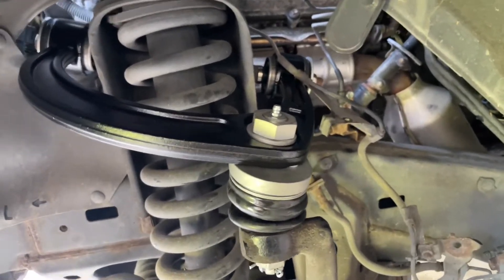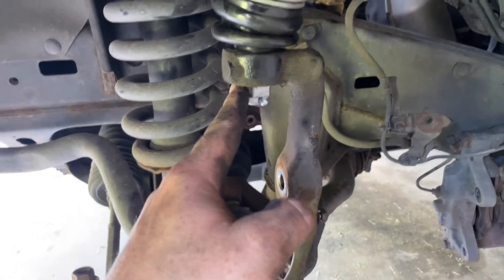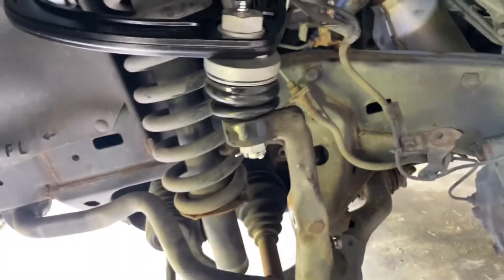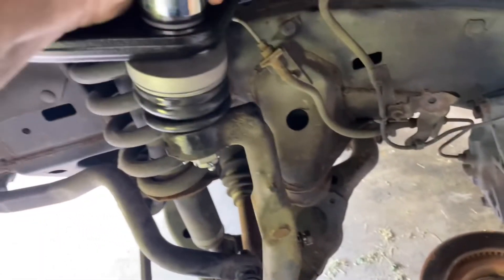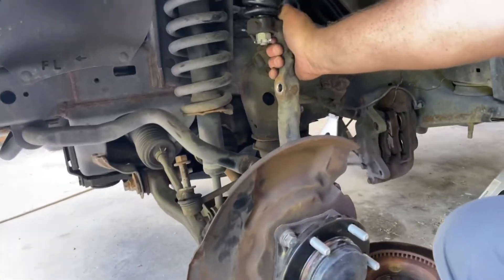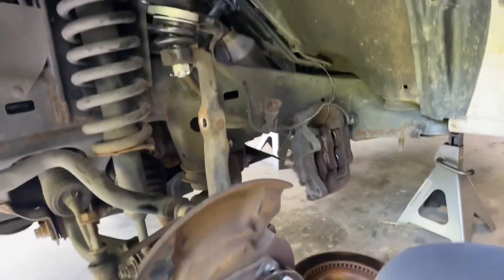I believe they call for regular wheel bearing grease but verify what SPC specifies — it may be a different grease. Five to ten squirts. The long frame bolt through the chassis uses 19 millimeter on both ends. I'm going to set this about where I like it — it's a bit tight — then loosen it back so I can change all of these angles based on the lift and wheel and tire setup. The shop will lock it in to 150 foot-pounds.